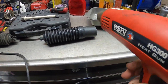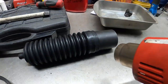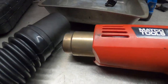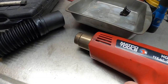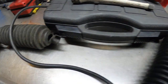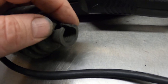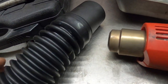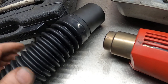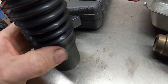I've been using a heat gun and heating this while rotating it — basically heating and rotating to get the boot stretched to stay big, because there's no way to get it slid over top otherwise. You can see how big the old one is versus how small the new one is — it's super tight. I just keep rotating it around and heating it up, then let it sit and cool down.